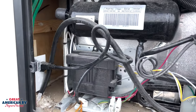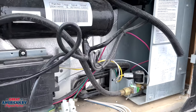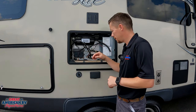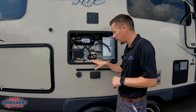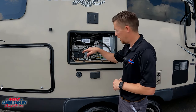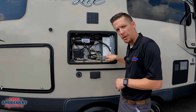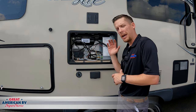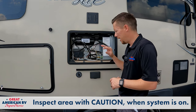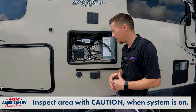Inside here we have our 110 receptacle with the plug-in — that's what I mentioned earlier. You can stick a phone charger in there and check to make sure you have power. We also have our 12-volt lines coming in. There is a fuse on the inside and a breaker panel for this 12 volts, so check that to make sure your board is getting power. We have our board, absorption unit, gas line, and the igniter and burner are behind here on the flue tube. Anytime you open this up, be careful — this area can be very hot, and you also have 12 volts and 110, so be very cautious of what you're working with back here.